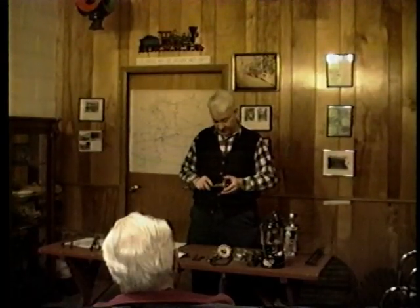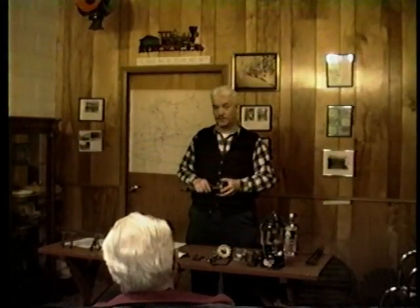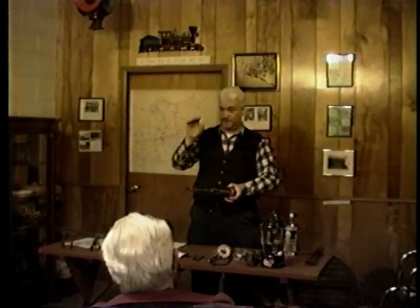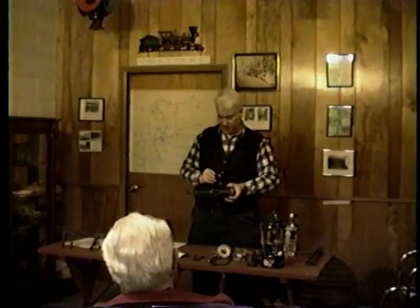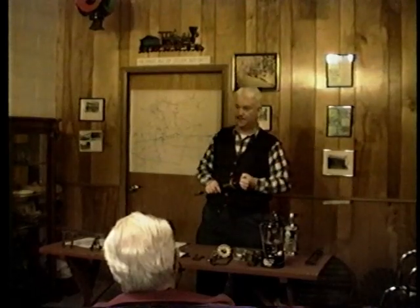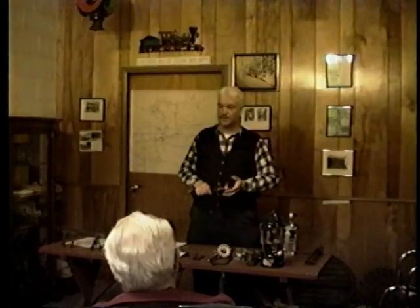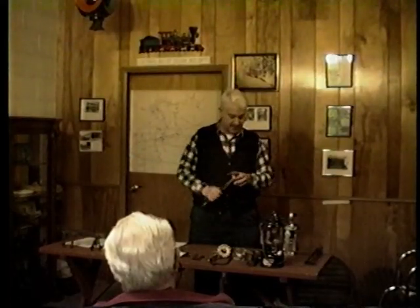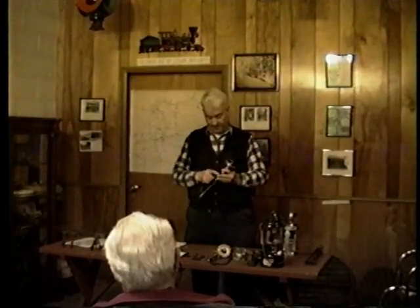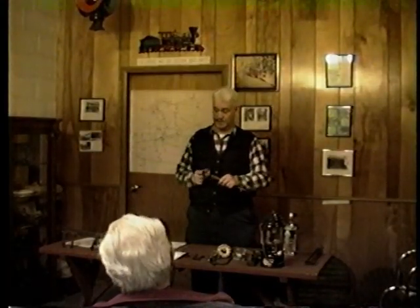We took the steam automatic off, took it apart, and this spring in here is a hell of a spring, if you don't mind the French. We pulled that spring out, and when you held it up to the light, you couldn't see any airspace through it. It was rusted so bad that it just wasn't compressing anymore, so it wasn't shutting the steam off until it really got a heck of a load on this end, and then it finally would shut it off. Tom looked around, and lo and behold, he came up with another spring. So we put another new spring on it. It's been fine ever since. So that's the only time I've ever seen one give trouble. And of course, you can set it anywhere you want, but you have to remember if there's a blow-off valve, that's going to go off if you set this too high.